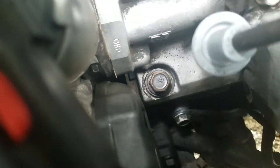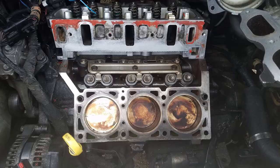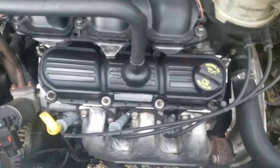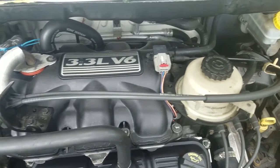Four, make sure you clean all your mating surfaces as well as possible. You're going to want to sand the heads and the block with 600 grit sandpaper and water. Put paper towels into the cylinders so you don't get any water into the block, then spray some water onto the surface with a spray bottle, and sand with 600 grit sandpaper. Spread it evenly so you don't make the head or block uneven, and do it until the surface is totally clean and smooth.